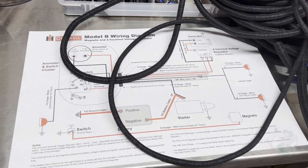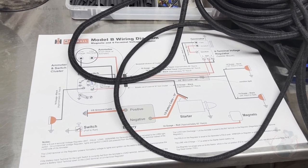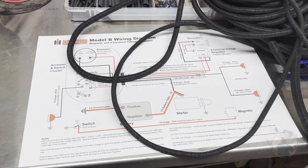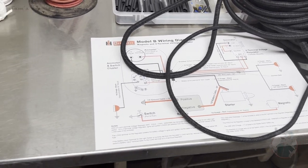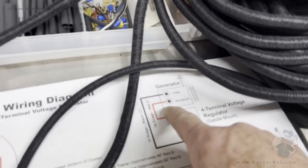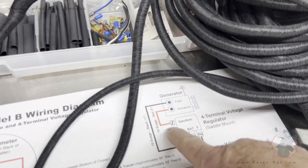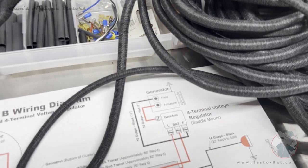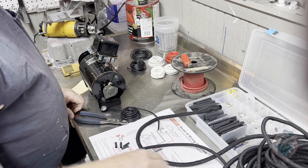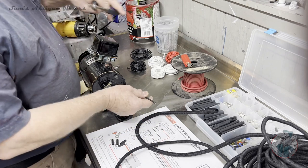And then I have my wiring diagram, which I've spent a fair amount of time perfecting and validating. So we're going to build it off of this, and I'll post a link to this PDF in the description. With that, I'm going to get the generator and first build the two leads up here that connect the field and the armature connection up to the four terminal voltage regulator. This generator connection calls for 10 gauge black and 10 gauge red.